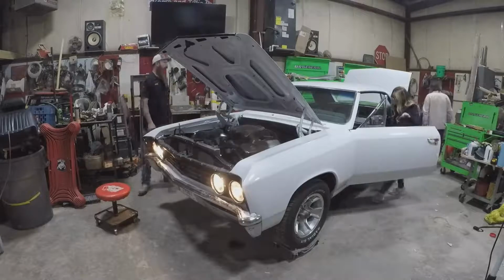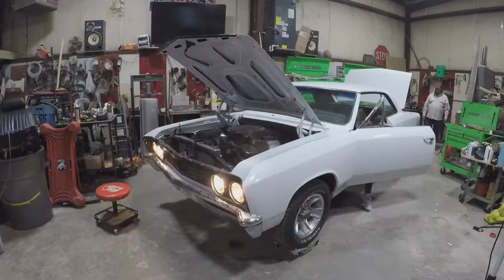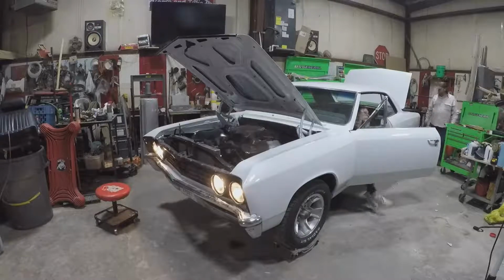Oh, okay. Let's see. There's no seat. Okay, turn the blinker back off, because that kind of didn't work right. Brakes? Yeah. Same thing. Turn the right blinker. So they just stuck on. It just goes dim. Ground issue. Yeah. Well, it's probably because these bulbs ain't on, or this ain't hooked up over here. It's true. If you hook your park lights up for those, that could help. Yeah, complete the circuit.